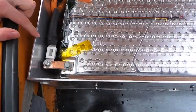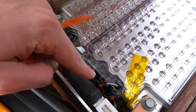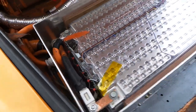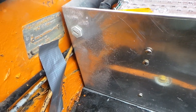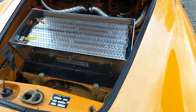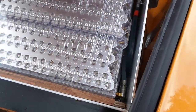This box is fused inside and we also see these print plates here — this is the CAN bus of the batteries. We also have a pressure relief valve, and this is for when gases expand in this box they can safely escape. On the other side we can see the liquid cooling system we talked about.